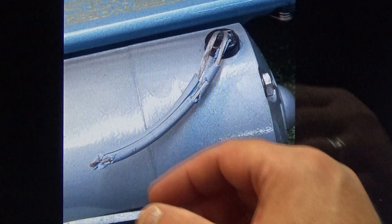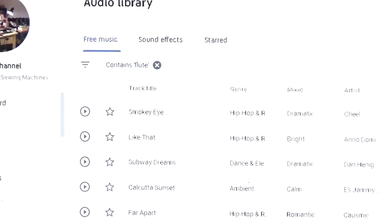And the only reason I said initially, in particular Japanese clone machines, is because the type of wiring that they use, this colored, decorative, matching type wire, wasn't really of the highest caliber sometimes. And that coating would have a greater tendency to become brittle and to break down. So, there you can see more in the shot there, the bare wires, really a fire hazard.